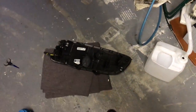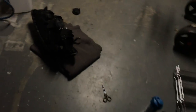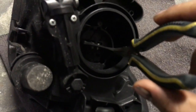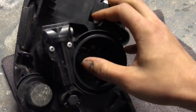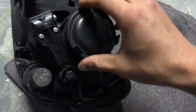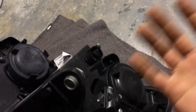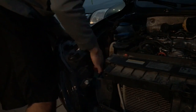We're going to put it in anyways. It's been about 10 minutes now, I'm going to check if it's dried. From the last video it was still light out, and now it's actually gotten a decent bit darker. Let's check on this — I'll put a plier on one side just to keep it against the wall. It appears to be staying, so I'm going to put the cover back on and throw it back in the car. Make sure you do put this cover back on the headlight — it helps keep moisture out of the headlight unit so you won't get fog in the headlight. It will also help keep your light bulb from burning out.